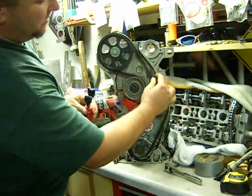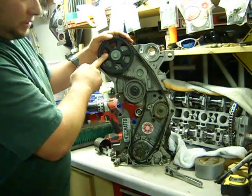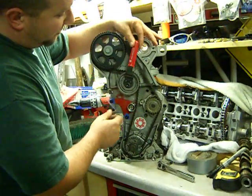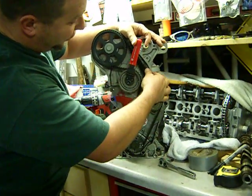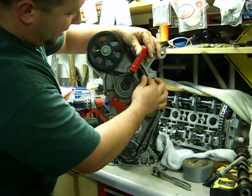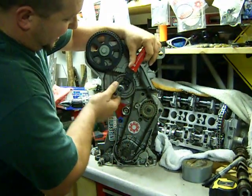Stick this tool — notice the belt, floppy loose. You will line up your timing marks. Stick the tool into the holes on the tensioner. You will tension the belt until you have approximately a 90-degree turn on the belt. You will have a nut here because you have a stud nut — this is just a bolt because it's something I play with. That is your tension. You set your tension.